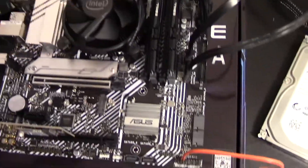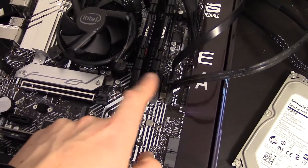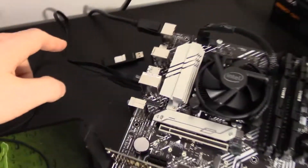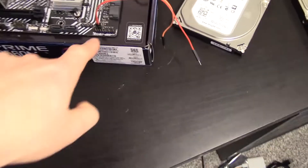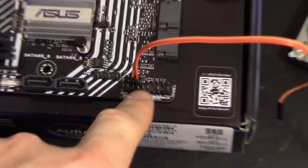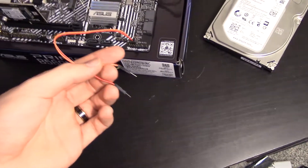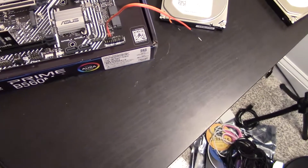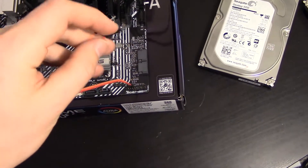I think we're good — there's no wiggle. I checked that the RAM does go in the second and fourth slots, so we're pretty much set. I'm leaving my Unraid bootable USB in and going to switch the power supply on. To power it on without a case power button, I took the two wires to the power switch and I'll just touch them together with a cable to establish momentary continuity.